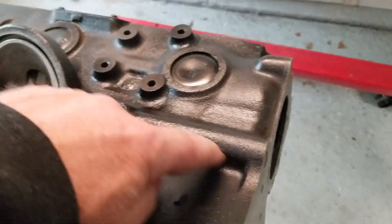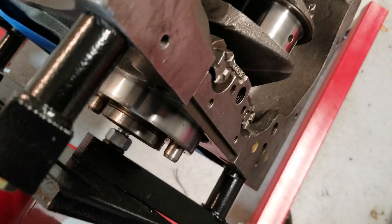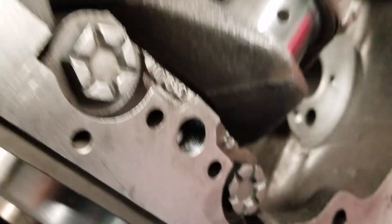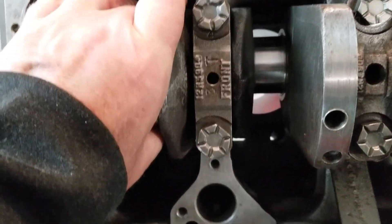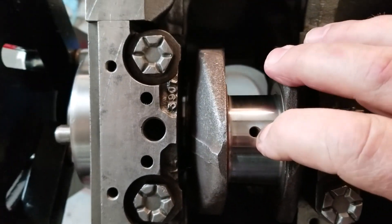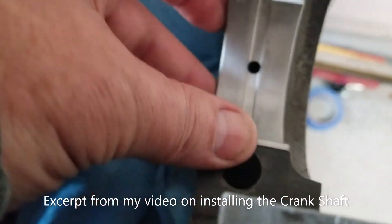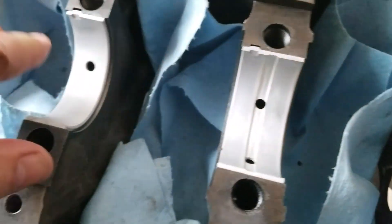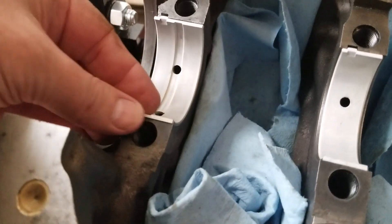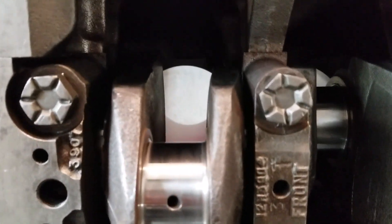This gallery probably stops right there, but they have the gallery so they can drill it out — there's a machining thing. But this then goes back to the main bearings. When you get to this point where it's feeding the main bearings, they feed through these little holes and feed the connecting rods. So there you have the new bearings in there — you can see they have a little notch that it goes into. The important thing here is just cleanliness: keep everything clean, no hair, no dust, no dirt. Everything has to be absolutely clean. Make sure they're nice and flush all the way across. The oil pressure comes through the main bearing and then feeds those connecting rods through the main bearings.